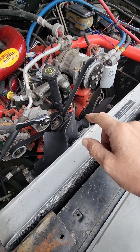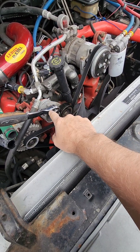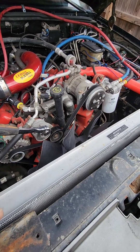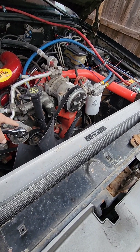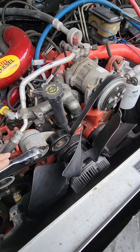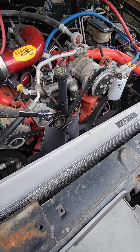I'm going to show you how you can do this without special tools like the air chisel. On this tensioner — yours may be different — on the 95 and older it takes a half-inch drive to release the tension; on 96 and newer there's a provision right on the bolt. I'm going to release the tension and I'll show you what I do for the water pump pulley to hold it still on the next one.